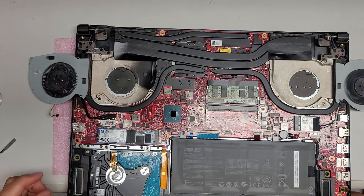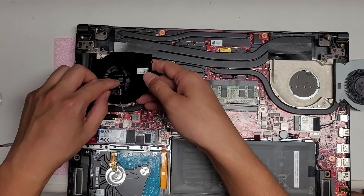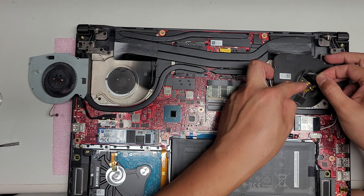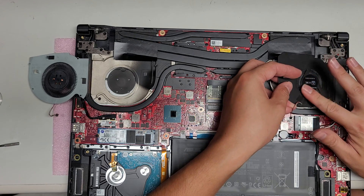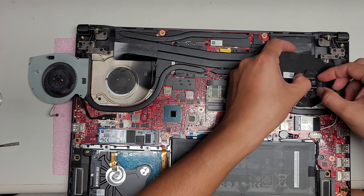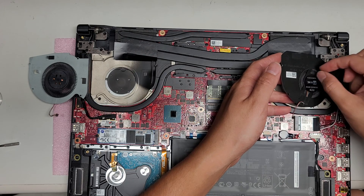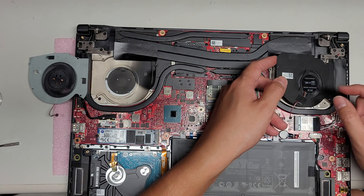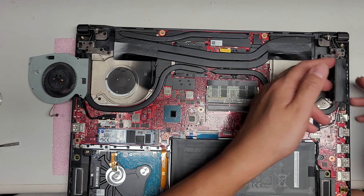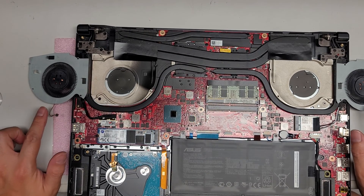So that's another trick to repair these kinds of fans. If it has the metal cover on the back, like I showed on this one, you might be lucky. If you're planning to just buy a new fan anyways, just try and force it out. Make sure to apply even pressure. If you have a special tool, or you can try and form something — like some rubber pieces that are all the same size and use a pad to push them all down — that seemed to have worked. So hopefully this video will help you guys if you have to fix your fans.